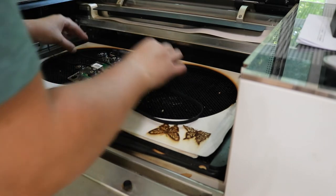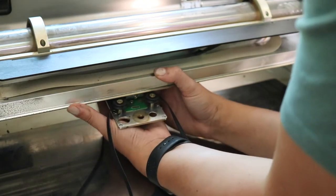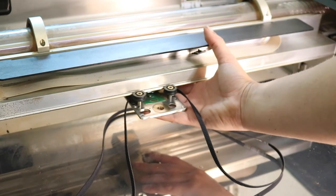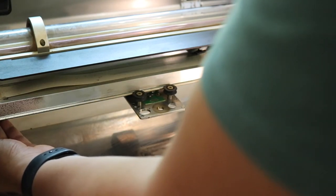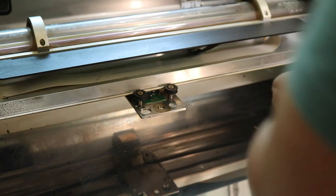Back to the video. I'm going to hold the carriage back and pull back the wheels first to get it up, and then with my fingers on the corner I'm going to pull the plate towards me to pop it back onto the arm. Then for the belt — making sure everything is straight — we're going to put it on the left wheel, put it on the right wheel, and then re-tighten the right wheel.